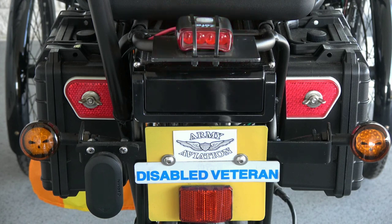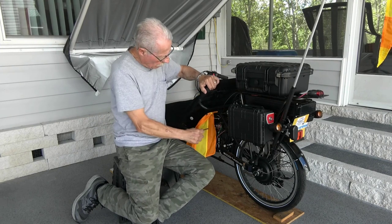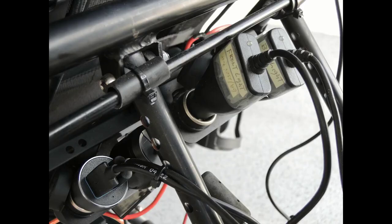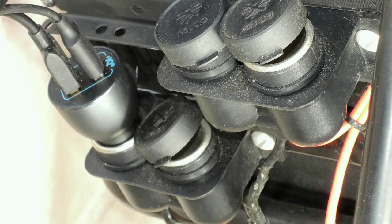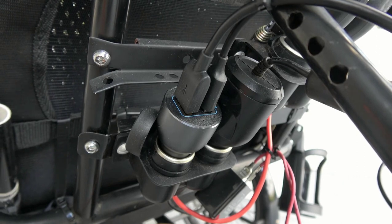Here you see the rear-facing strobe light — it operates on 3 volts DC from the 12-volt battery by way of a DC adapter. Now, how does this 12-volt power get reduced and distributed? I have mounted four cigarette lighter outlets to the back of my seat. These 12-volt receptacles provide power to six different accessories that each require less than 12 volts. By using a DC adapter in-line, we can choose how much voltage goes to each circuit. These outlets power the front strobe light at 4.5 volts, the rear strobe light at 3 volts, the Garmin GPS at 5 volts, and two Garmin radar units — both the rear radar and display screen at 5 volts each — as well as charging the bike alarm at 5 volts. One outlet provides power to both radar units using one receptacle with two 5-volt USB ports.